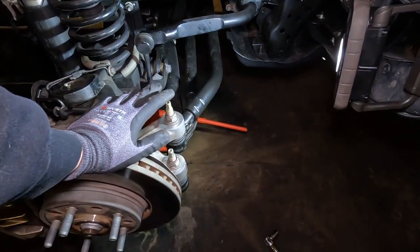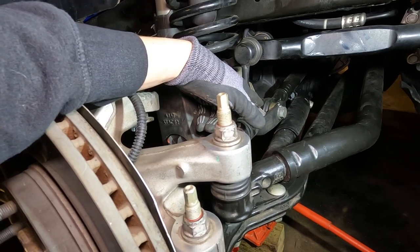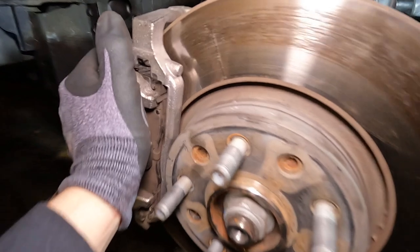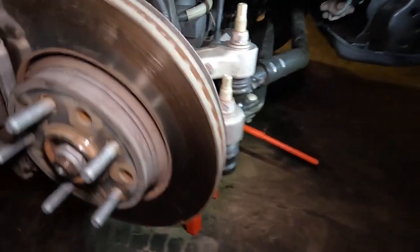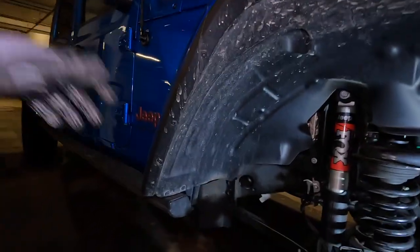Sunday I will be taking the wheel off and we'll see if we can get rid of that noise. Well guys, I am at a loss. It is Sunday. I took everything apart again and took a look at it. I tightened everything I could — I tightened the tie rods, these guys, my steering stabilizer, I checked the sway bar links, I checked the tie rod, I checked my drag link, my track bar on both sides. I honestly think it is the ball joints and — oh, now it's not gonna do it — oh, here it is. It still does it. And after going off-roading yesterday, I've come to the conclusion — speaking with another gentleman who has a Gladiator Rubicon — it is probably this aluminum knuckle.